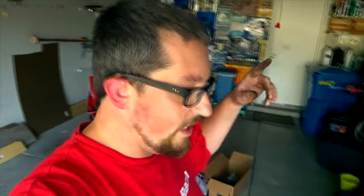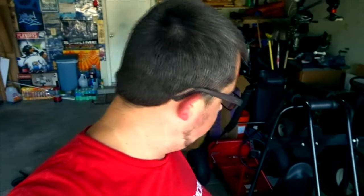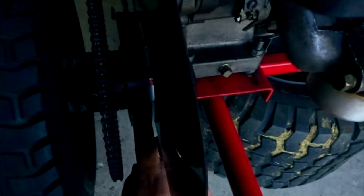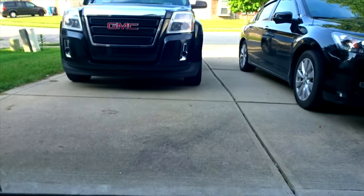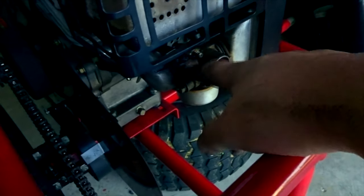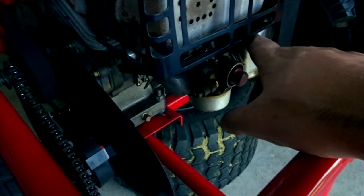Alright guys, so there it is - we changed the brakes on this go-kart. This is the band brake system - you will see that is the new band right there. It works pretty well. It is kind of stiff right now, but I think once it gets worn in it should be okay. I think the next thing we do is just let it roll down the hill and make sure it stops, because the engine is running a little rough right now, which will be something we tackle in the next video. We'll be changing the carb.